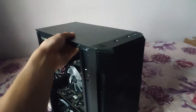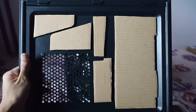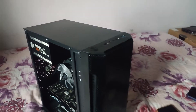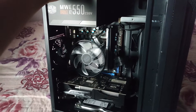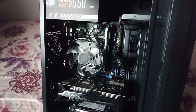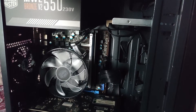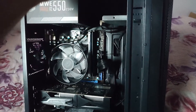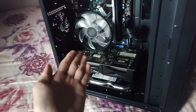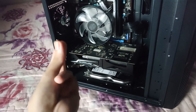As I was trying to test it the next day — I didn't use this PC much — the PC did not post. And that was with the side panel closed. It's a very janky solution to make this side panel dense enough. I did some simple troubleshooting: taking out the GPU, trying the onboard video since the i5-3570 has Intel HD Graphics 4000, and re-seating the RAM and changing it to a different slot. But no effect. I had to reset it by taking out the CMOS battery, waiting a while, putting it back, and powering it on — and it was alive again.